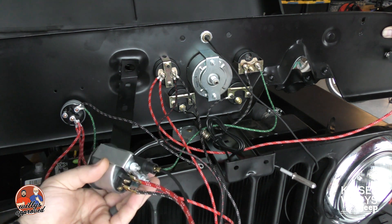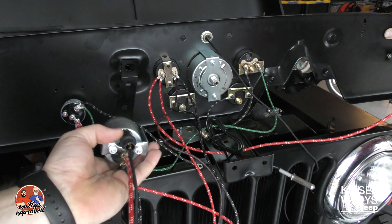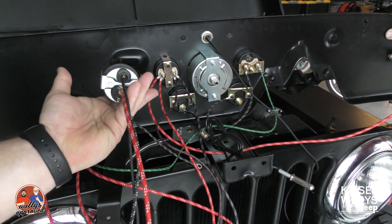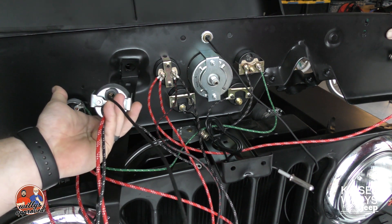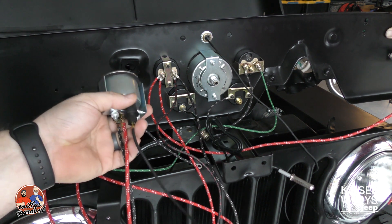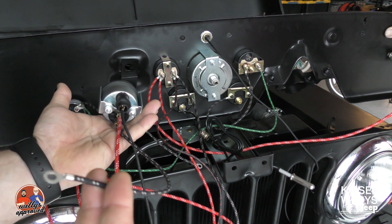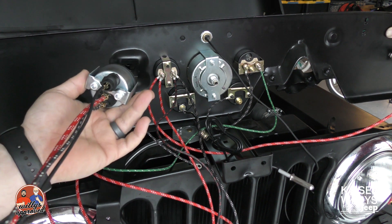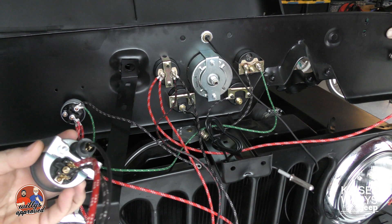Take your voltmeter — you can see it's got push-on blade terminals here and here, and this is your light. Essentially it will take the place of the amp gauge. You'll take your power lead and run it back over to the ignition switch. What I did was put a separate wire on as a toggle to go along with my dash lights, so when the dash lights come on, so will the pilot light for this. Then you've got your negative, which is a ground — you can tag that just about anywhere you have a solid ground.